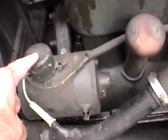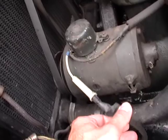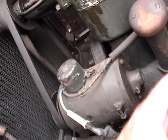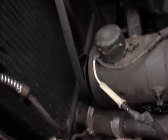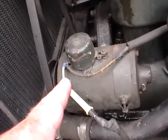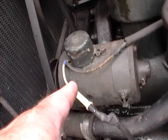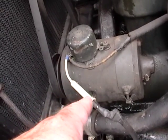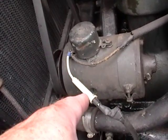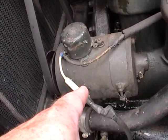Right here is the relay. This is a six volt generator. Somebody's done a little bit of electrical work in it. So when you hit the key, the charge comes down here and turns on this relay. If this relay sticks, then basically when the engine's turned off, you're using the battery to try and run this permanent magnet generator as a motor. And of course it doesn't have the juice to push anything, so you just burn out your battery real fast.